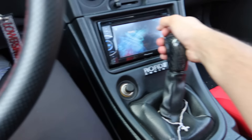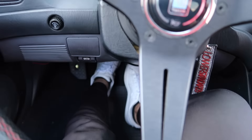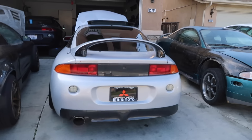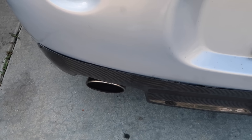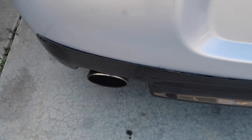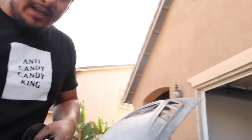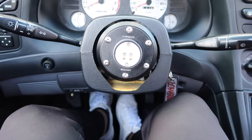Next you're going to take it on a test drive. First, make sure the radio, AC, and accessories are working. After that, start the car and make sure all your gears go in perfectly. Once you start driving, make sure the temperature gauge isn't overheating and feel how the car drives as far as suspension, clutch, and power. After the test drive, come to the back of the car and check that there's no weird exhaust smoke — such as blue, white, or very dark black — those are signs of a blown head gasket.